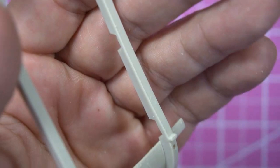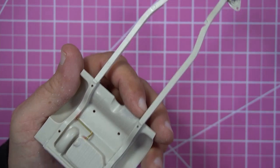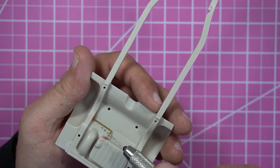Back to working on the frame. We're going to take away that wire that's molded in up the side of the frame, and then we're just going to make our own wire and bring it up. I'm not sure if I'm going to let it hang or actually try to bring it into the engine. We're going to make two holes into the side of the frame — this is how they had the wires run before. So we'll use our little drill bit here and poke a hole at the side so I can tuck the wire in and bring it across, then do the other side too.